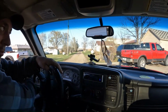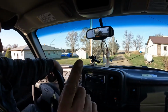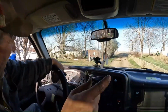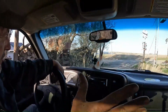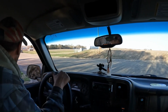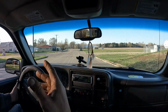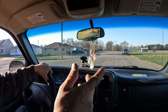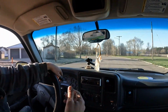So, on the newer pumps, where they changed the pigtail on them, the gray and the thicker black, because there's two blacks, are reversed, or else it's running the pump in reverse. So, gray goes to black, black goes to gray, if you run it back to your original factory pigtail or harness. So I was like, what's going on here? I know I tested it, it worked. So when I did that test light test, well, of course I had one to ground, I had them hooked together, so of course that's gonna light up. It's not gonna tell me that it's spinning the pump in reverse.